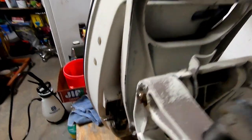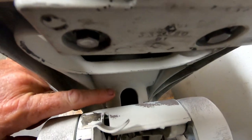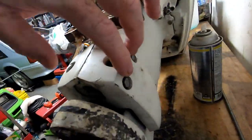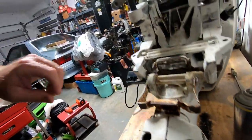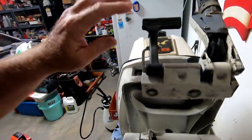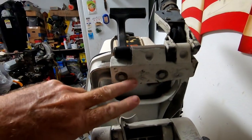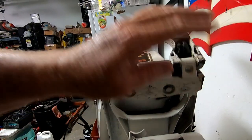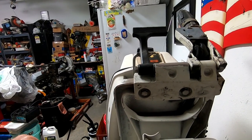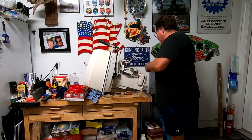To get this off I got to remove these nuts here — the main motor mount down in there, the nut is broke. I got to remove these two bolts, these two side bolts, take this motor mount bracket off, release these two on the sides, and then try to get this whole piece out. I got to move the shift lever and handle out. These two bolts on the bottom act like they don't want to move and I don't want to break any bolts. The whole idea is to get through this without breaking a bolt.